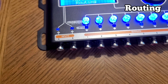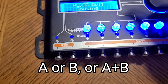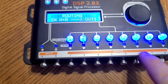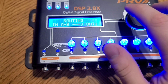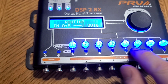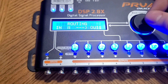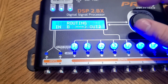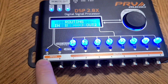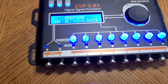The routing is very important. A lot of people don't use it, but you really should if you're trying to do stereo sound or have multiple equalizers. The routing is basically A and B inputs. By default, A and B are merged together as a mono signal and then sent to all the outputs. You go inside routing and choose the output. You can press the buttons and it automatically switches. So if you want A on output one and B on output two, you can go to output one and change it to A, then output two to B — now you have left and right. If you have two equalizers, you can put one on A for your mid-bass and one on B for your highs, assigning outputs one and two to A and three and four to B, controlling them with individual equalizers.